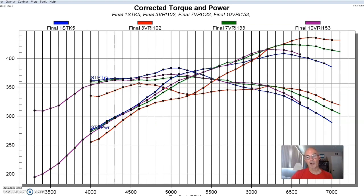That's what you'll see with changing runner length — it actually produces a sine wave. We got our second part of the sine wave way out at high RPM, but it didn't make as much torque as it did down low. This is exactly why it's so valuable to be able to adjust the runner length: if you just built the shortest runner and saw peak power, you wouldn't know that adjusting it just a little bit might mean losing a little top end but gaining 30 or so foot pounds of torque.